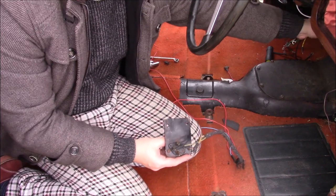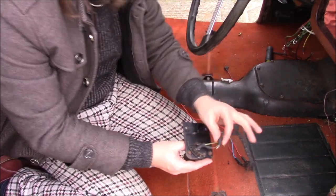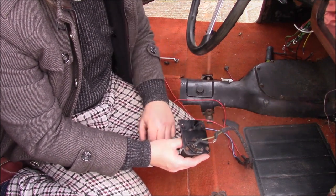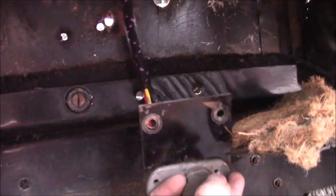I can't really show you because it's all the way back here, but what I'll do is put each new wire in as I take the old one out so I shan't get them muddled. There's the new harness up there. I still haven't figured out exactly what the route is so everything's very loose — it's not clamped in place. New wires come down to the switch and that then fixes to the bulkhead through those two holes.